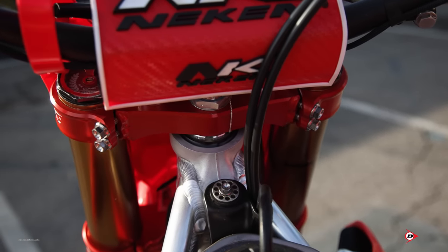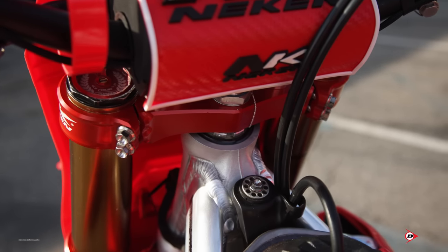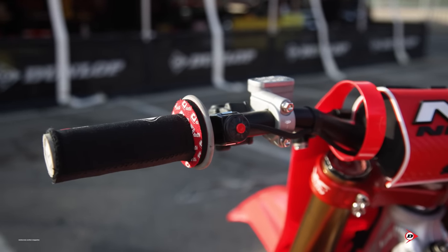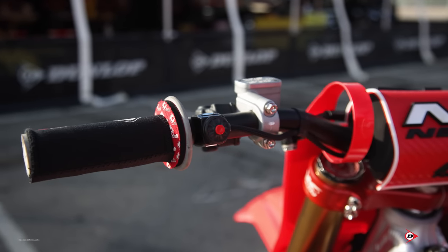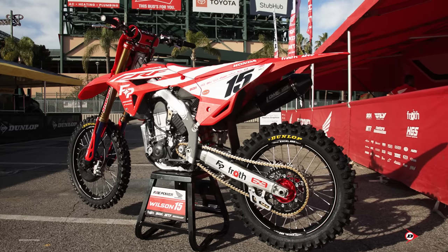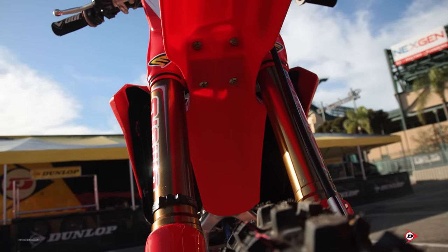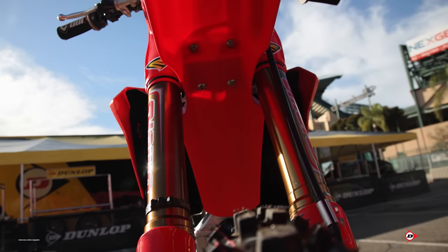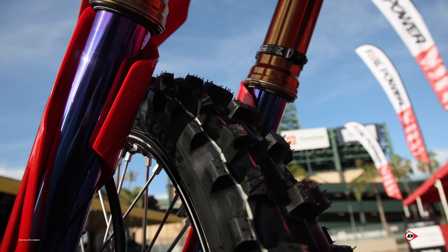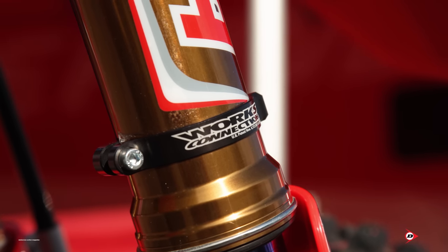When I first started working with Dean it was on the looser side, but we've just been tightening the steering up and he hasn't been complaining - it's kept a little bit straighter through the whoops. Standard kill switch for the old two-strokes - we don't switch between maps during racing so it simplifies the bars, makes it look a little bit nicer. Showa kit front forks coded - he's working with the Showa technician so they've got that valve dialed in for him.